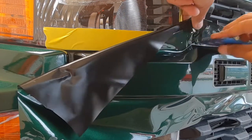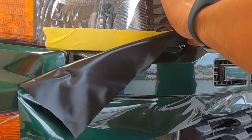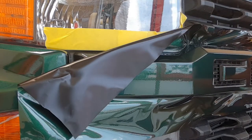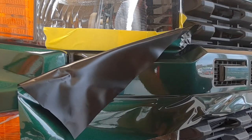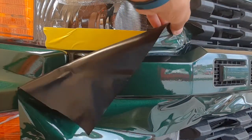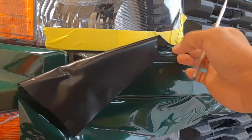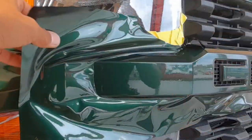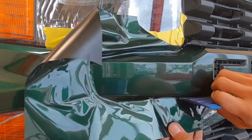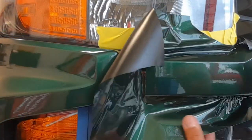Here's a closer-up view. That first dip is where I stopped before going all the way on the flats. I laid the vinyl over that kind of peak and swept it out to the left and to the right, then trimmed off the excess on the top flat to get good corner and ledge coverage. I'm creating a relief cut that looks nice and smooth and clean, ensuring that I get all the way in and cover that without any stress on the vinyl. On the passenger side I'm doing the same — finishing up the bottom flat underneath, tucking the vinyl under to where it meets the plastic trim piece.